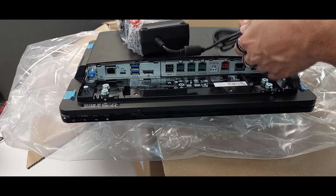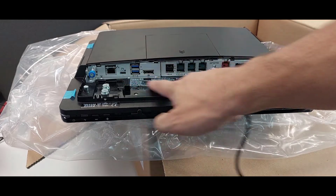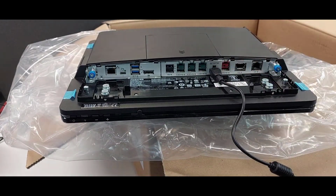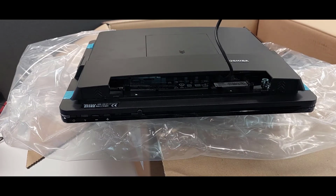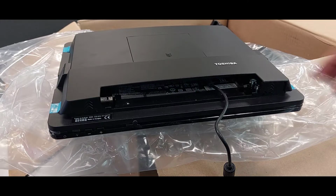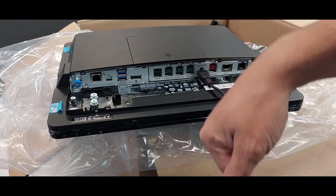So what you'll do when you go to install this is plug all your cables in, feed them through the pole as you need to. If you have an all-in-one already, all you would have to do at this stage is essentially swap out the power, because it'll all be the same connections more or less, with one exception I'll talk about in a moment. So what we would do, we'd have all our connections plugged in like this. You would try and feed them all so that they're down. You would come across and put your display on just to make it look neater, and then this would go up into your pole. All right. So that's how you do the back plate with the cable and the point of sale. So just keep in mind when you are wiring it, it's going to go down underneath that cover and then back up through to the pole.